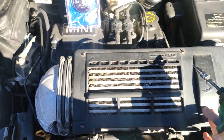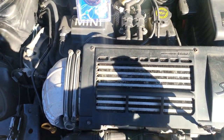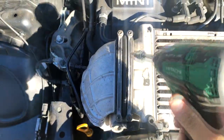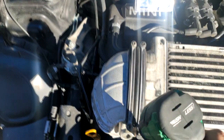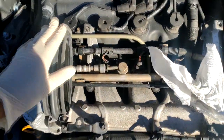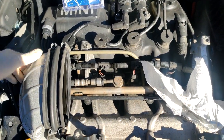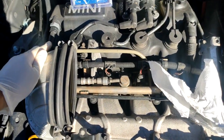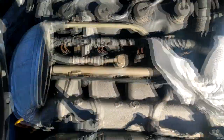The first thing you want to do is remove the plastic shield that goes over the intercooler if your car has the stock intercooler. This uses a T30 Torx socket. Then remove the bolts that secure down the rubber seal that seals the intercooler to the intake ducts of the supercharger — also a T30 Torx socket. Next, remove the rubber coupling so you can access the vacuum port located on the back of the snorkel of the supercharger. That's where you'll be tapping in your vacuum line for your boost gauge.